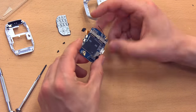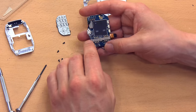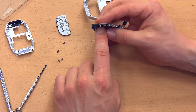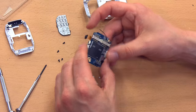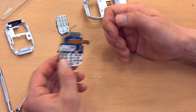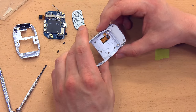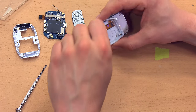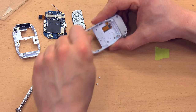This circuit board is undoubtedly the actual phone circuitry — probably the processor and whatever chip they use to connect. There's another antenna — it says RF right there, so this is definitely an antenna. I'm not sure if one is the cell antenna and the other is Bluetooth or vice versa. It's a neat little package. The software on this phone, despite having 32 megs of RAM and 32 meg ROM — tiny by today's standards — was actually very usable and clearly well designed. To my eye this circuit board and the phone in general is well designed. Pretty impressed with this overall, despite not having too much use for it in my daily life.